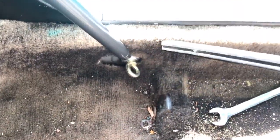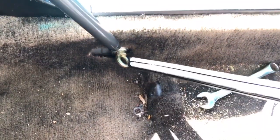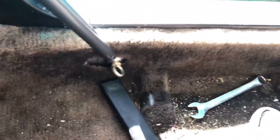I also had to take out my seat to give myself extra room. Take off the carpet, remove the seat — it's not necessarily required but I highly recommend it. After you take this little plastic protection cover off and remove the seat, you're going to put the wires up and pull the carpet back toward the outside of the car so you get that room to actually put the bolt in. It's going to take a while to fit because you have minimal threads showing. But it's in there — I just got to tighten this up.